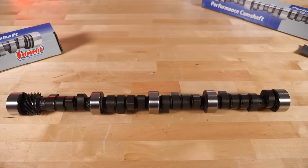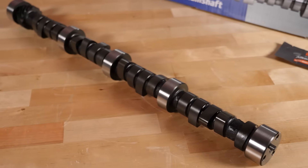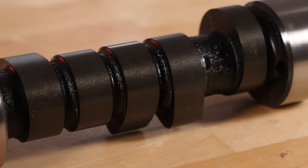When we move the joined firing orders from cylinders 5 and 7, which are the furthest from the water pump, to cylinders 2 and 4, closer to the water pump, we remove hot spots in the combustion chamber that cause detonation. This helps head gasket life and reduces header gasket failures.